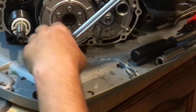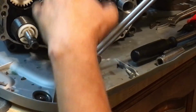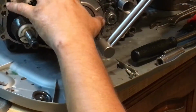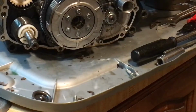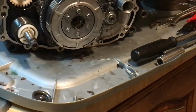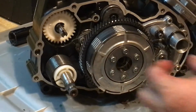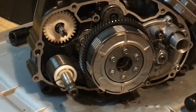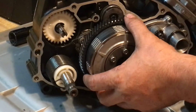Just double checking them all. That's after I did the crisscross pattern. I think I already did this one, but right. Okay. Alright. So after I torqued them, I'm back over to double check them all, because you don't want to over tighten those things. Those things right there will snap and then get fatigued. You'll stretch the bolts. They're under immense pressure anyway, being in there with those extra added springs, which can be an absolute nightmare to do.